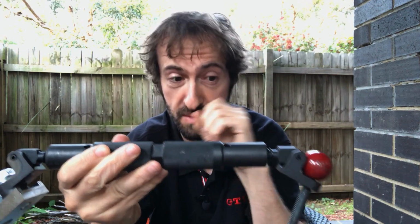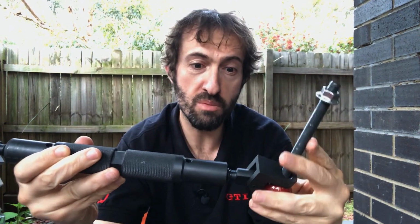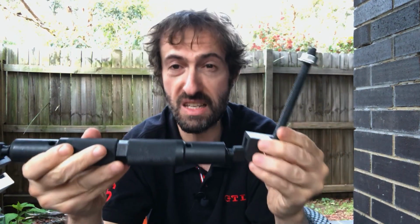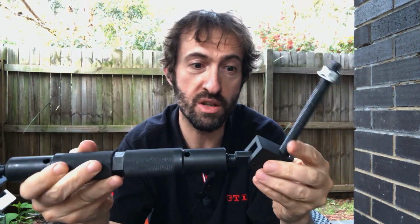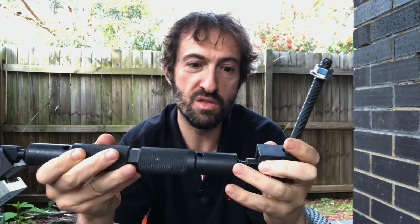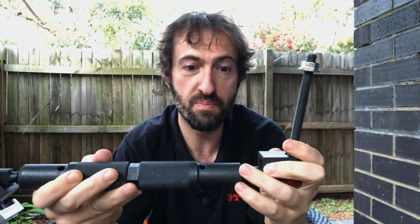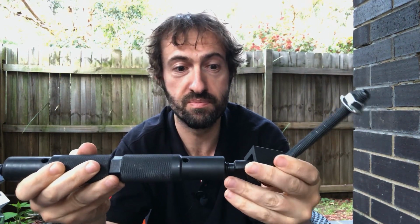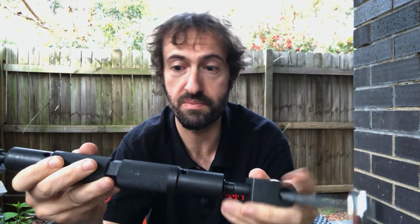I did, however, install the lower control arms. Wasn't that difficult. The most difficult part was probably relating to this. So what is this? This is a tool that the workshop manual actually refers to for the install for DSG cars only. If you've got a manual transmission car, you don't need this. This is used to separate the gearbox from the lower control arm so you can actually free a bolt. Otherwise, there's just not enough space.